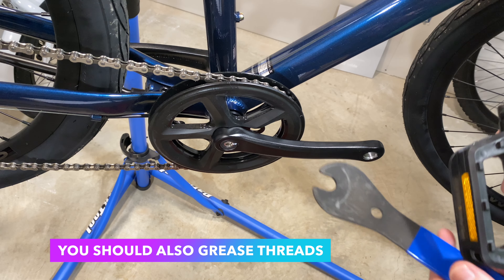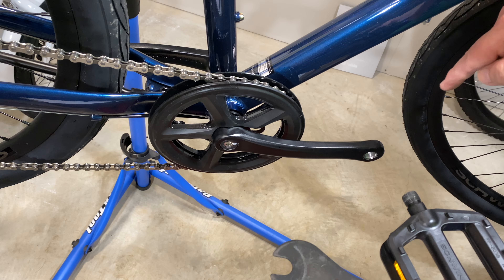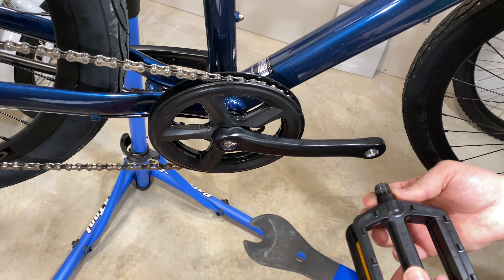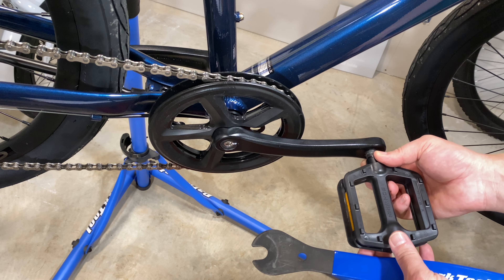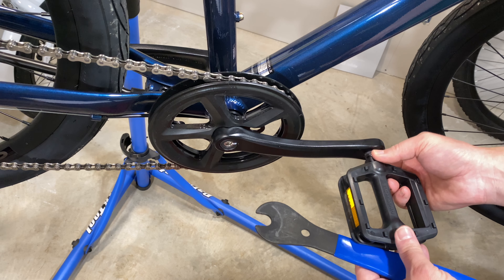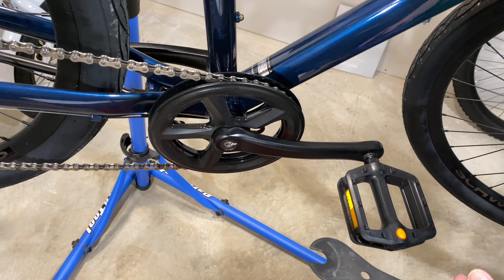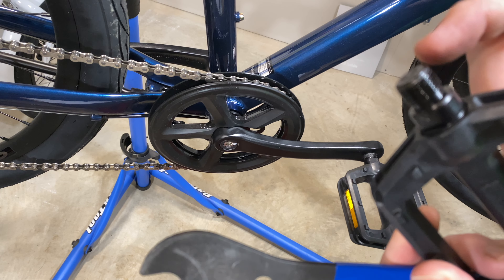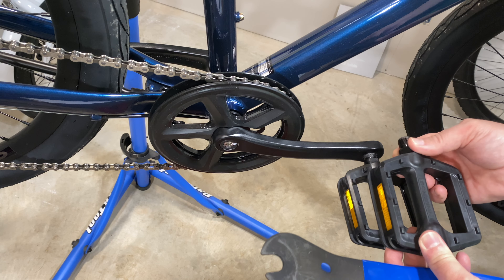This tech tips video is about something basic with bike assembly — putting pedals on a bike. Once you know it you know it, but if you don't it's easy to get messed up and end up with a bike you can't even pedal. Over the years many people have told me they got their bike in the box, put it together, went to put the pedals on, got them mixed up, and stripped out the threads. Usually the crank arms are alloy and the pedals are steel, so you can guess which gives first.